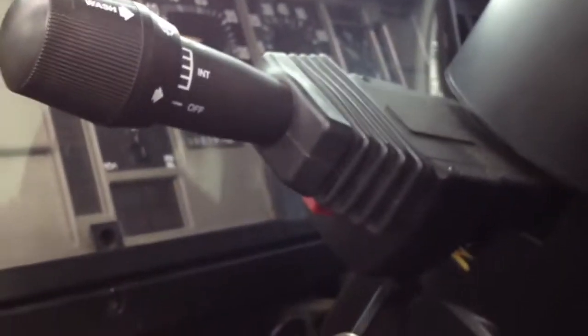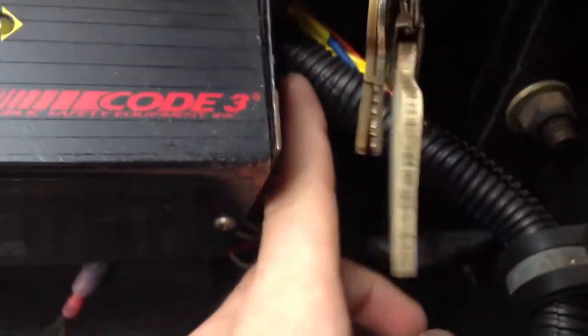I don't know if you can see it there. It's hard to see. It's right there, right next to my steering shaft that comes down. So I put that in, and I just wired it right to the turn signal switch, because in an International, the brake lights go through that. It's three wires, that's it. I just hopped right into the wiring harness right here. And I put in a separate plug, so that way my transmitter was never out in the elements.